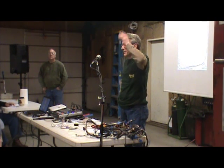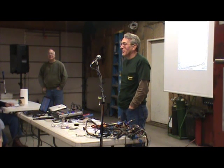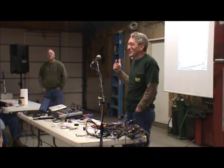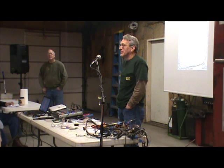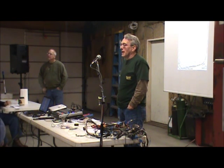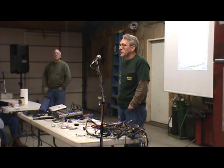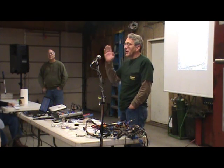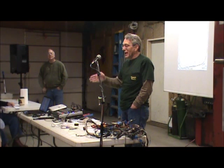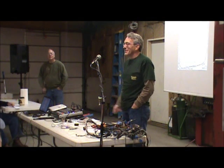That's the Stag parked out there. That's mine, by the way. That's an 18 ACR alternator, and that car needs every ounce it can get because it has air and power windows and all that. I don't know if that alternator is big enough considering all the loads. The new car is going to be 100 amps easily, which is why one popular upgrade is putting the GM alternator on your regular TR6 without air conditioning. I put a 16 or 17 ACR on my Mini, which is basically a radio, fan, and wipers. When I'm sitting at a traffic light on a cold morning with the heater going, the wipers running, and the lights on, that voltmeter is at 12 volts. I improved it, and it's still not good enough.